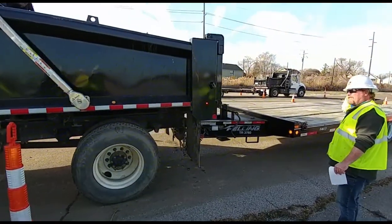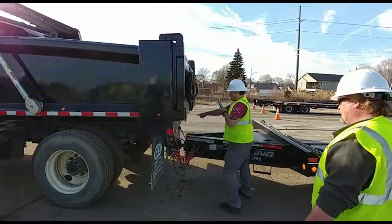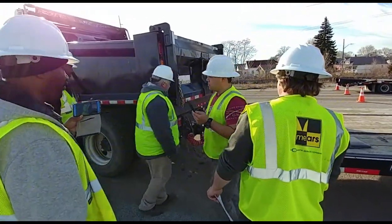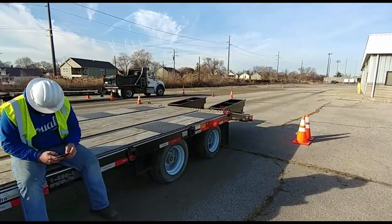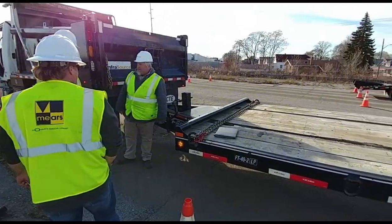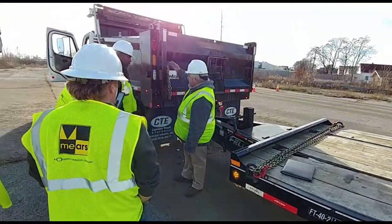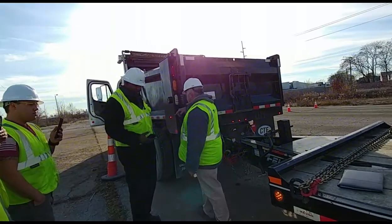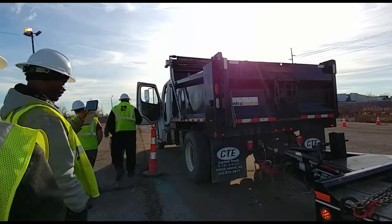Okay, which one is right with the ID light? Individually? The 3 on the side. That's what I'm asking. Yeah. That's the three lights to classify it as a heavy truck. Yeah, the 3 in the middle are ID. You have 3 back there too, but they're all red in color. Markers. You'll get those when you walk back in. Marker lights are low, clearance are high. And the one I didn't get on that paper was the clearance lights on the front. On the front of the dump bed, yeah.